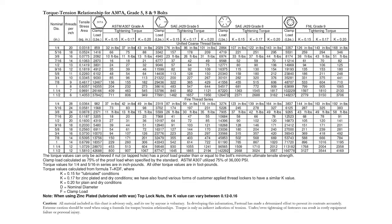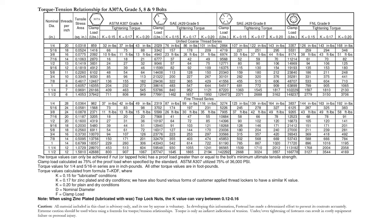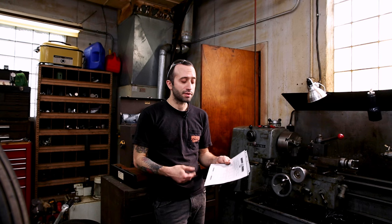So to help with torque specs for places not found in your service manual, we printed out this cheat sheet from Fastenal, and you'll be able to download a PDF of it in the description of this video. And it's great. It lists all different grades, fine thread, coarse thread, and torque in a range. This chart's really easy to follow and gives you the proper recommendation for the grade hardware that you may be using. The chrome hardware on this bike doesn't have the notches on the head of the bolts.